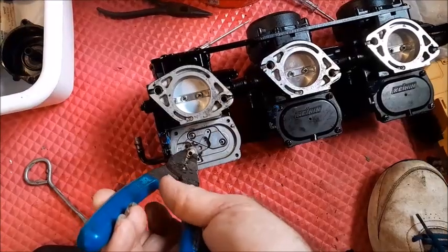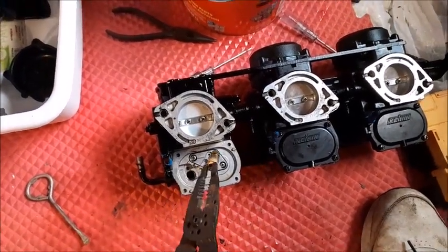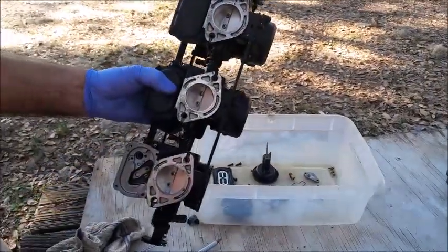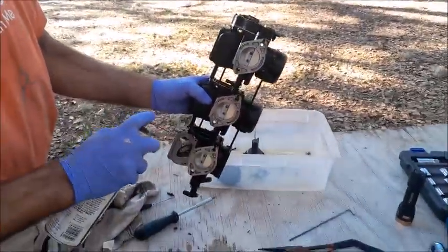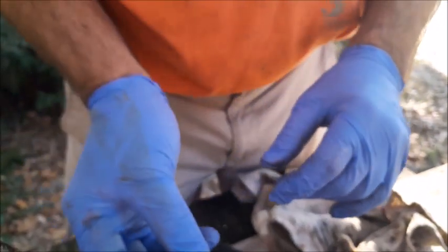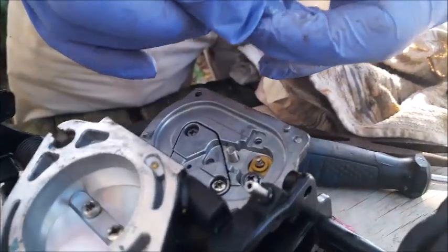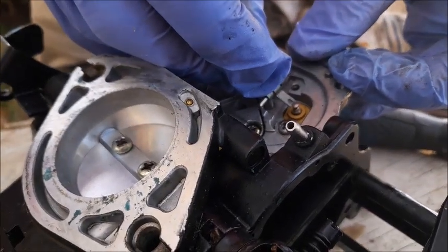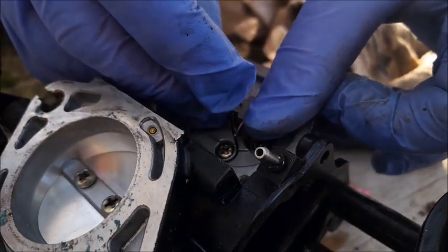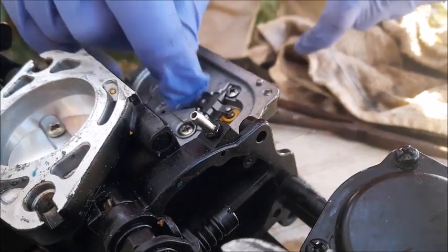We just pulled these carburetors out of the solvent — it was soaking overnight and now it just pulls right out perfectly easy. The holes in the side of it were actually plugged up, so it's a good thing we took the extra time to soak it. We used our brush and gasoline to clean this up, then spray it with carburetor cleaner to make sure there are no fibers or anything on it. There's a little pickle fork which goes underneath the needle valve. There's a little dent in the back side that goes over the spring. Slide it in a bit so we get underneath that lip of the needle valve, then come right down on top of the spring. You can test it to make sure that needle valve is going up and down and the spring is pushing it back up.